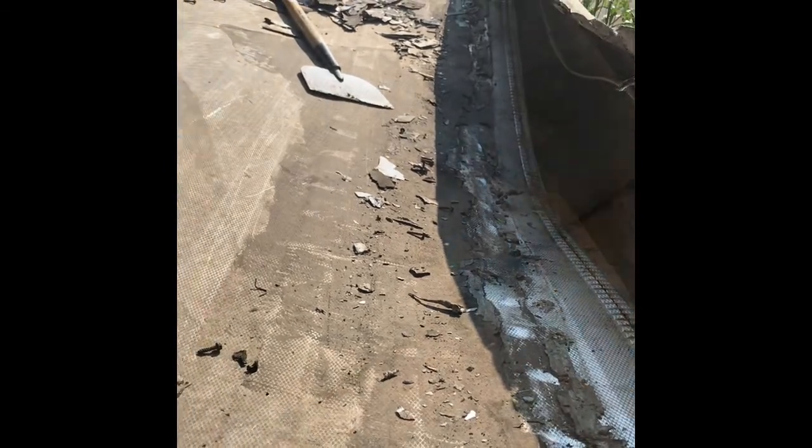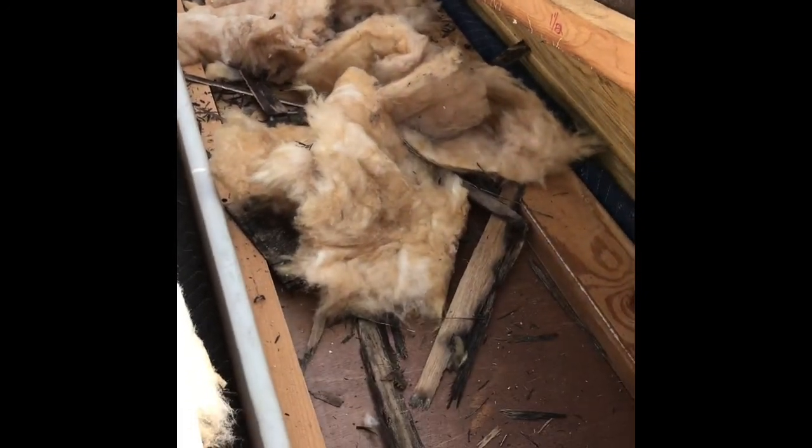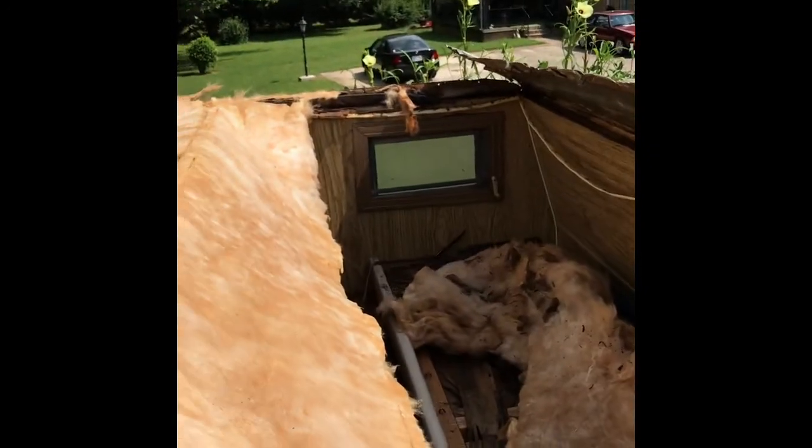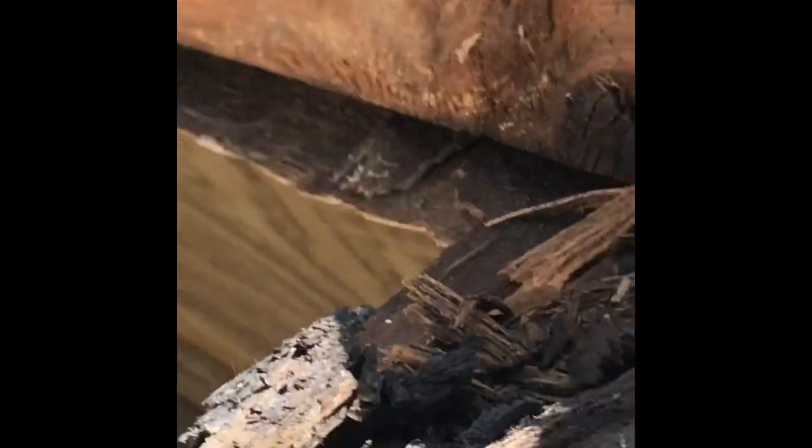I've opened up the roof. You can see the front cap and the interior wall — this is actually a loft bed area above the couches. There's some damage above that window, and there's wood rot right here that I'm going to remove. The trusses sit inside the wall, not on top of it. I'm going back in with 2x4s instead of the original 1-inch material. I've decided not to go all the way back — I'll scab the rafters in the rear since there's just a vent there, but up front I need to be beefier to support an air conditioner unit.